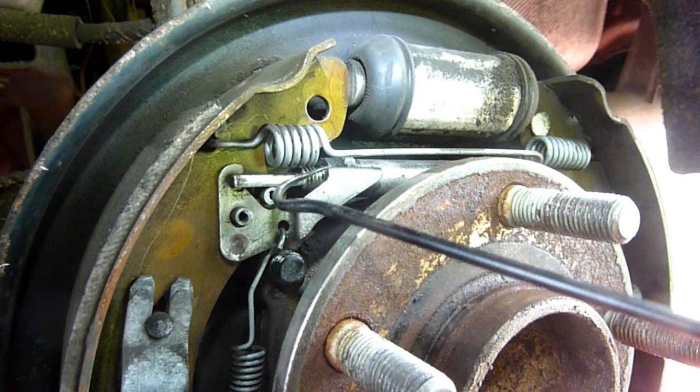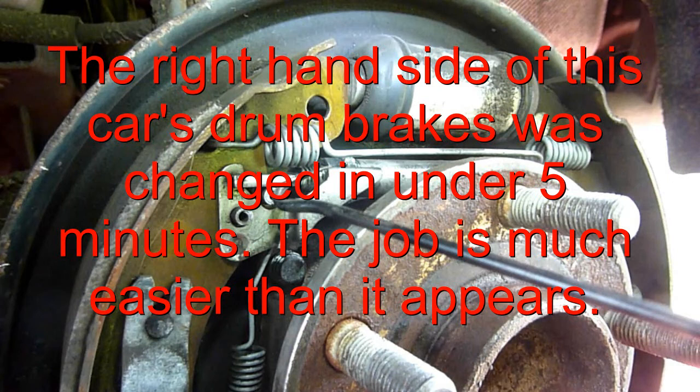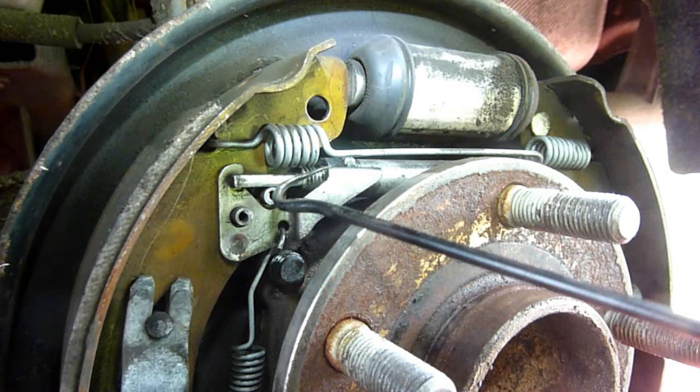Don't worry about left hand, right hand thread. Move the tooth cog in a way it can naturally go, so don't go against the ratchet. Leave the ratchet as it is, that metal ratchet, and move the cog just one tooth only. Remember that, one tooth only, in the direction that it can freely go. Be warned, don't move it any more than that, because you do run the risk of overheating. And of course retest for heat.